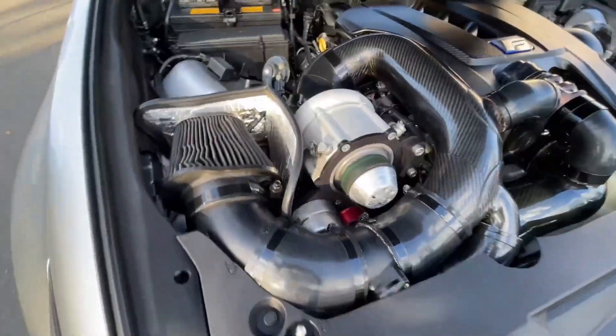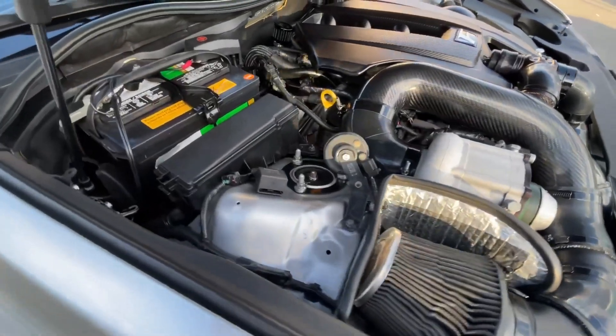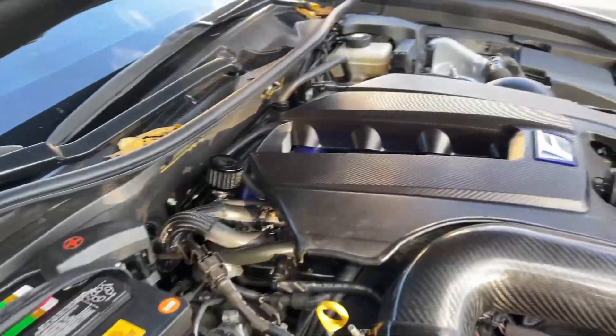These work like turbos — instead of using exhaust gases to spin up the turbo, they use the crankshaft like the other two. So they need to spin really fast to make boost, just like a turbo. It doesn't spin fast at low RPM, so it doesn't have the traditional supercharger feel where the power is instant. It has a power band that builds with the engine, making big boost at high RPMs.